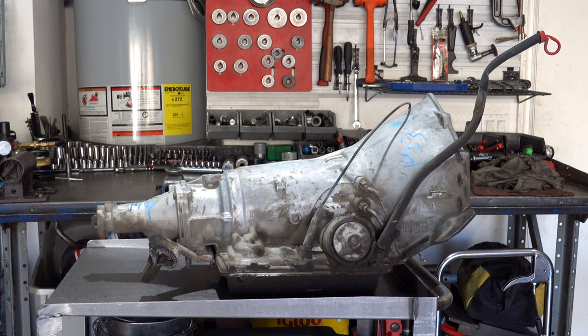For first generation 700s, there is an '82 to '84 vintage, which is defined by the 27 spline input shaft and correspondingly narrower pump stator or stator bore. Under no circumstances do you want to use an '82 to '84 700 for any kind of performance or heavy duty application. Those 27 spline shafts were notoriously weak and had a reputation for failure, and it's well deserved.